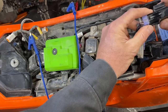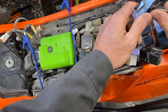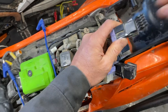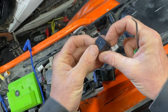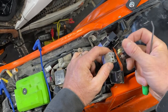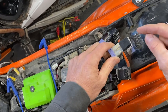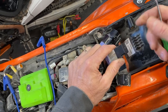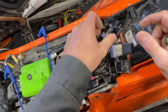If you wanted to replace just the relay itself, there's a second set of tabs up on the top. You just release those and then you can pull the relay itself out. If you wanted to replace just the relay, these are Panasonic — super common automotive type relays. These are single-pole, single-throw relays that you can probably order at an automotive shop. You would have to cross-reference it, but they'll be able to look it up with the model number on the relay. If you needed to go to a car parts store, you could source one — you don't have to get that from KTM.